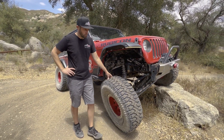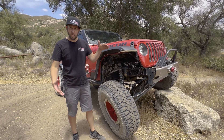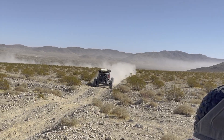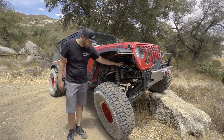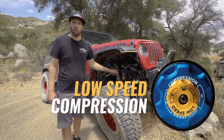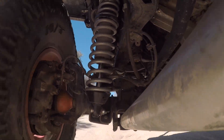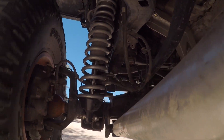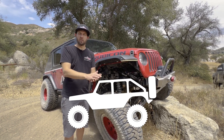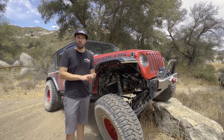So in the name we have dual speed — two knobs — compression. It only does compression, which is when the shock is compressing, like hitting a hard bump. That's what this is going to do. The first knob on the outside here is low speed compression. Low speed is the speed that the shock is moving, not the speed of the vehicle. So low speed is like a G-out — the chassis comes in and the shock compresses really slowly. That's low speed compression.